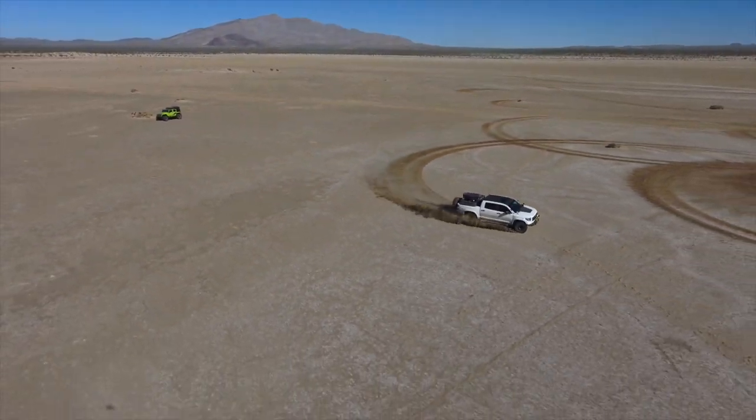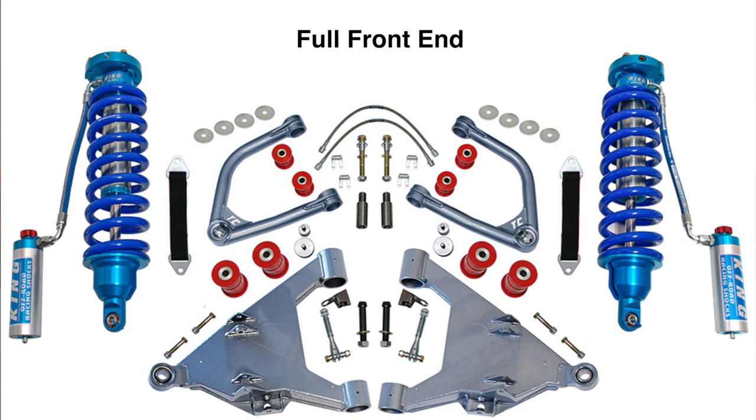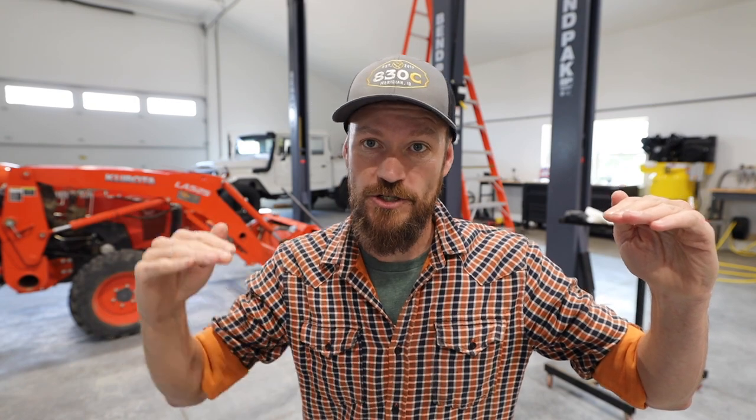It's a very capable suspension system. If you have no interest in spending $20,000 on long travel, there are cheaper long travel systems available. The major difference is they're not going to have those triple bypass shocks — it will extend your upper and lower control arms for the distance of travel, but it will only have a coilover in the front, so you're going to rely on your bump stops a lot more. Those systems are significantly cheaper — about half the cost — because you're not adding a second shock and not absorbing the cost of triple bypass shocks. They usually offer a little less travel and less control, but realistically almost none of us even need long travel in the first place. This is definitely a splurge, so you need to choose your own adventure based on your budget.